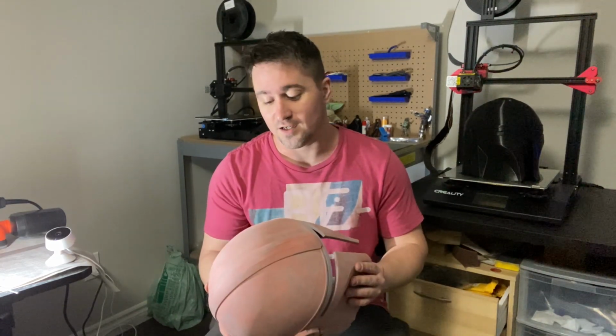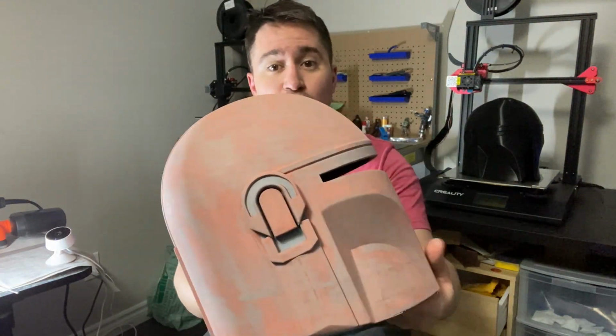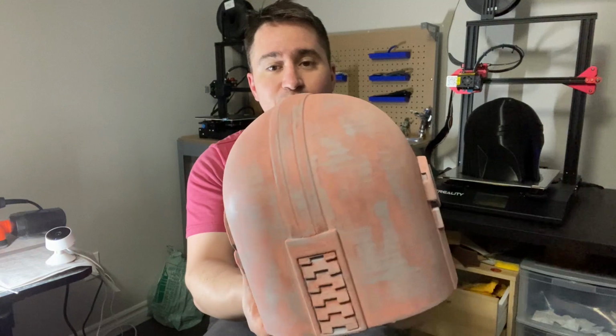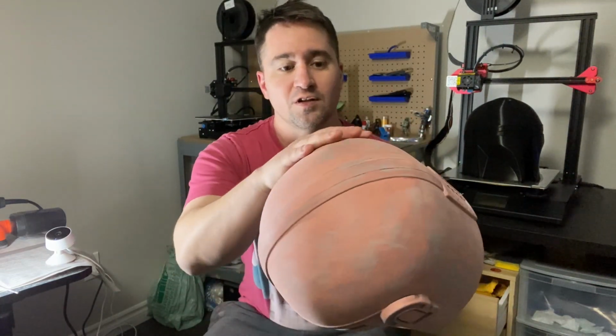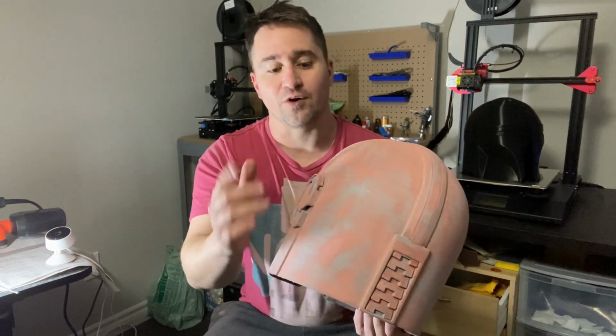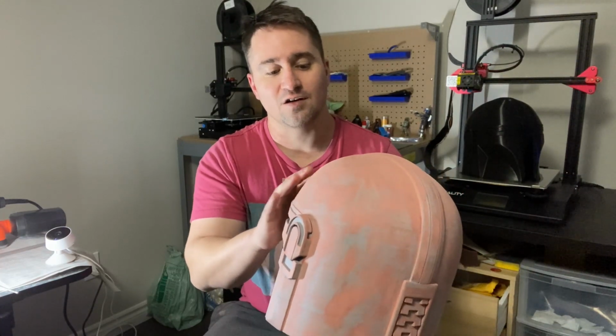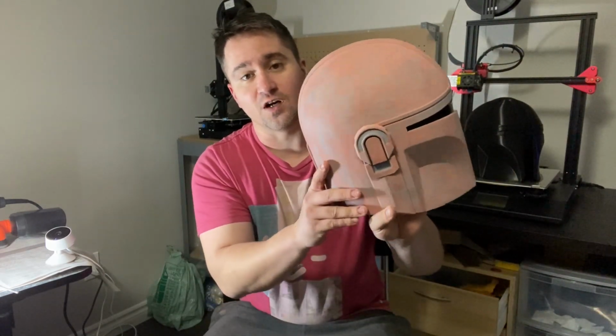Okay, so here we are. I couldn't convince or even bribe anybody to come outside with me today because it's so cold. But I went outside, I sanded it down. I didn't go too far. I just got enough that it was basically smooth. Like it feels smooth to the touch, might not look it. But with these huge lines, I'm not worried. Like I said, I did one layer of the filler primer, and then I slapped the entire thing full of Bondo.